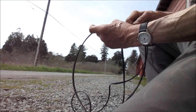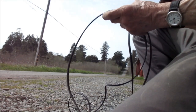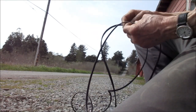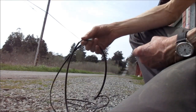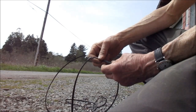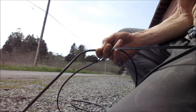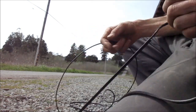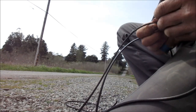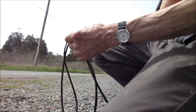You basically match it up where it broke — this one actually broke here. Sometimes you can tell by the belt if it's been overloaded. Usually if it's a clean snap then the machine's been overloaded. You can look at the belt and see if it has checks in it; if it has checks then it was on its way out anyway. This one doesn't have any checks in it. Basically you match it up and see if it's the same length.